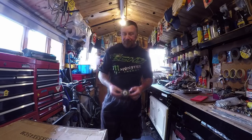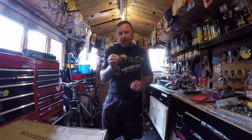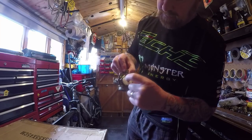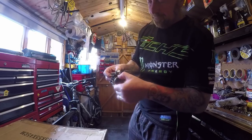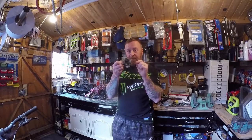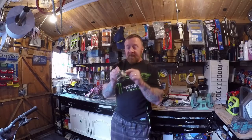As for the shut-off valve vacuum, I did fit the proper one and that worked, but it still leaked. Turned out it was the float. On the Speed Fight one there's a little clip here that stops it going back and forwards; on the Chinese one it just sits in — it doesn't clip on — so it wasn't shutting off. I took it off; this one's plastic but on the others they're metal and you just have to adjust it a little bit.